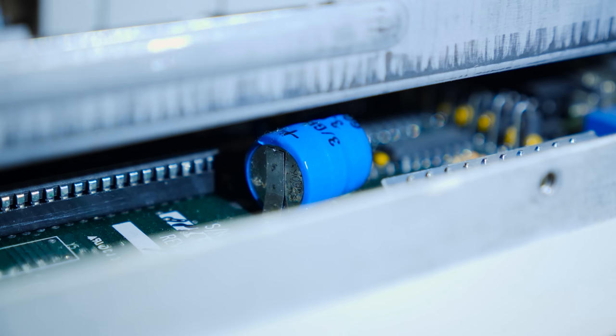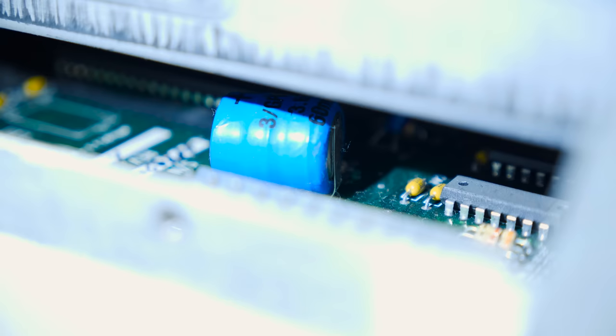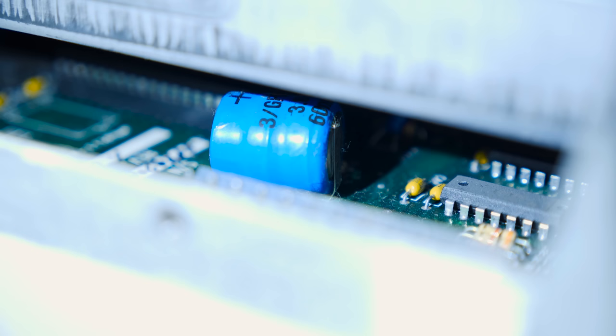The VX88 does not have one, but the PB500 absolutely does. It's got a Varta barrel battery on the motherboard soldered in there, and it looks clean from this side, but from the other side, I can see a bit of corrosion coming out there, so hopefully it hasn't done too much damage. Honestly, it looks okay considering some of the nastiness I've seen over the years.